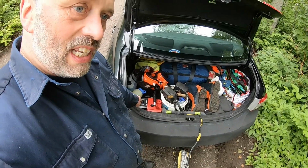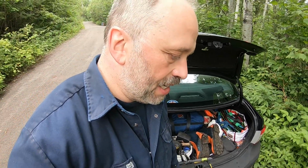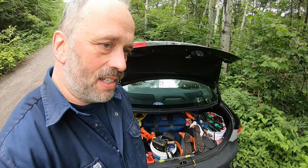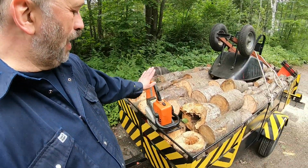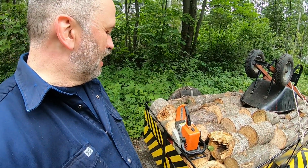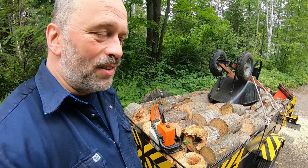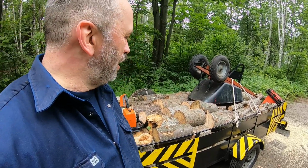This chainsaw is always clean. I have no oil, no gas. It's my backup. Once here, I start very well. Then I oil the piston head with engine oil, non-soap oil, SAE 30. And yeah, this is my dirty one. So air compressor, and then I'm gonna clean it, oil it, and yeah, I think my shed will be close to being full, but I think I have maybe 1 or 2 rows empty.